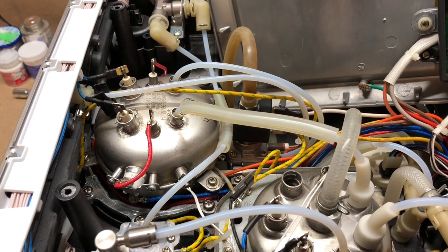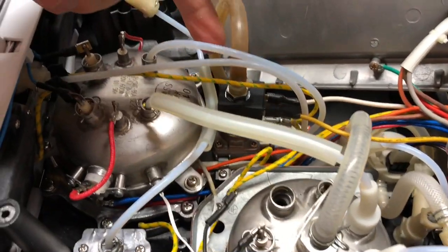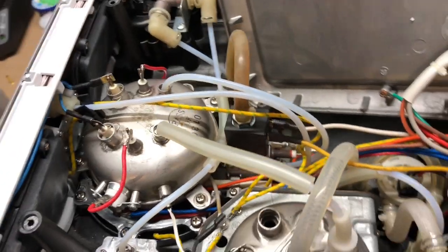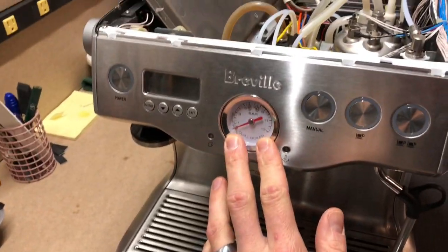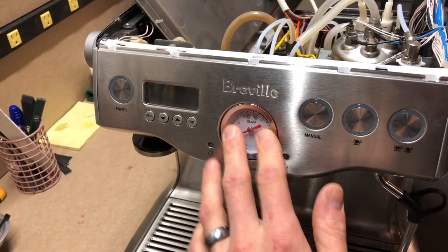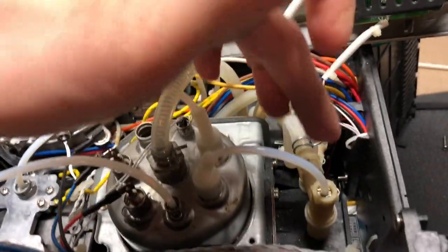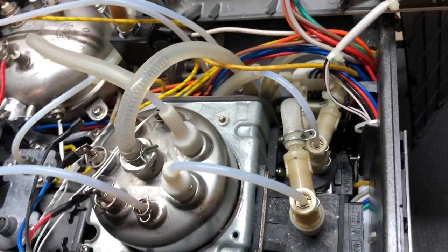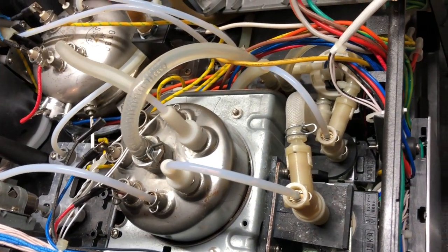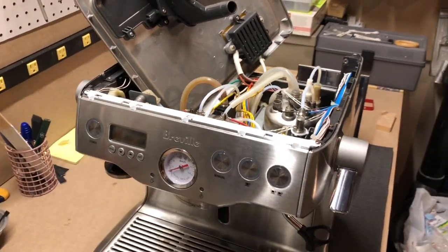I've got a couple of other videos to mention. If there's concern with the machine making loud noises, leaking, or not achieving full brew pressure, the most common problem on this machine is the solenoid valve — I'll do another video on how to replace that, it's actually quite simple. I've also done a video on how to pressure test your machine to confirm the gauge is working accurately, and how to replace that gauge — a really challenging task I wouldn't recommend unless absolutely necessary. Lastly, the overpressure valve sets your brew pressure and is really easy to adjust — I'll cover that in the solenoid video. Thanks for watching and good luck with your descaling.